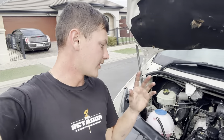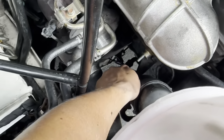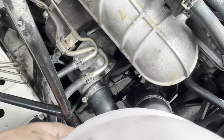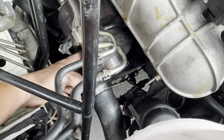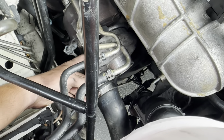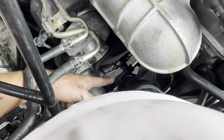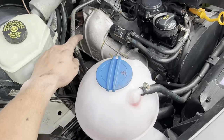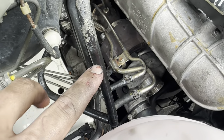I've just got the one I couldn't get, and I'm going to nip up the one I could get and double check it's all good. Clean up all the leak, make sure that was the leak. The mechanic thought it was a braided line — there's obviously a braided line down there — but it was actually the two bolts under the turbo holding the drain, they were loose. What was happening was the oil was dripping down, following the pipe all the way down onto the braid.